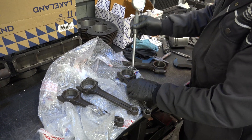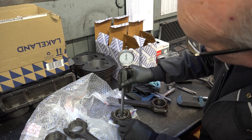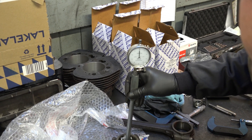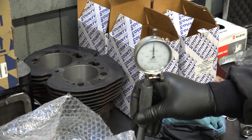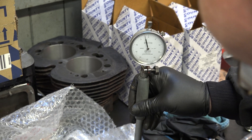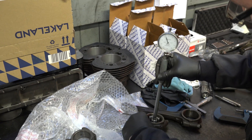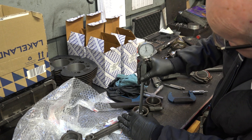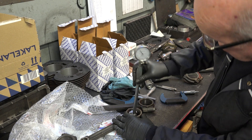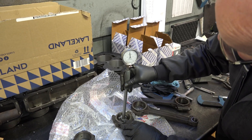It's pretty tight tolerances, isn't it — scary tight, especially in old Jeep engines. They don't always come out that way; I've heard they're often very poor. That one is much the same — just over a quarter of a thousandth of an inch over, pretty much the same, half a thousandth over there. So the seller was right — they have been checked! Wow, that's incredible. Well, let's hope the remaining two are the same. That's very good for an old engine.